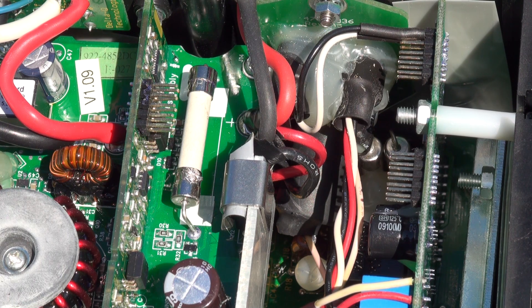Ours is a 48-volt battery system, and this is called a quick charger. This is what the inside of it looks like. The problem with these is that the charging terminal on the side burns these pins up, because the pins just really aren't big enough, in my opinion, for the amount of current they're pulling.